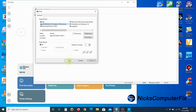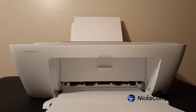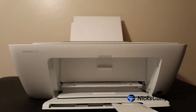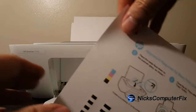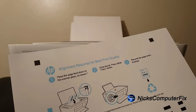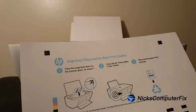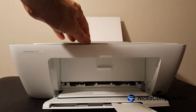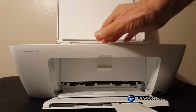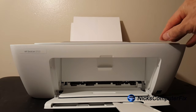I'm doing a test print from Notepad — I clicked Print and the printer is printing right now, and as you can see the clarity and the print is good and easy to read. Now I'm printing a print head alignment page. Whenever you get a new printer and want the best print quality, you need to align your print heads. You print this page out, put it in the scanner, and it scans and aligns the print heads automatically — all done through the software.